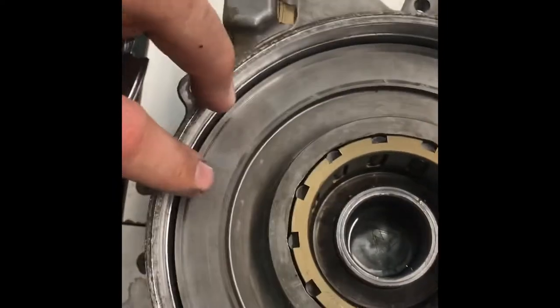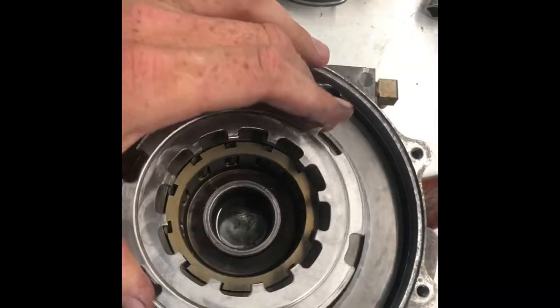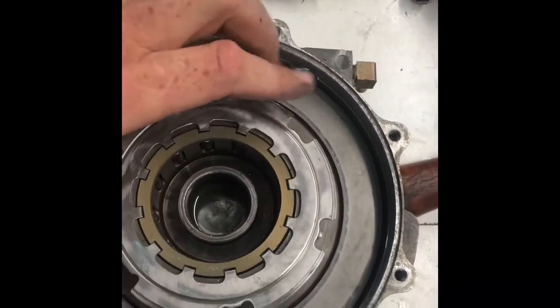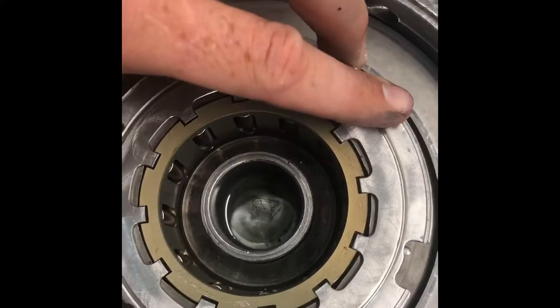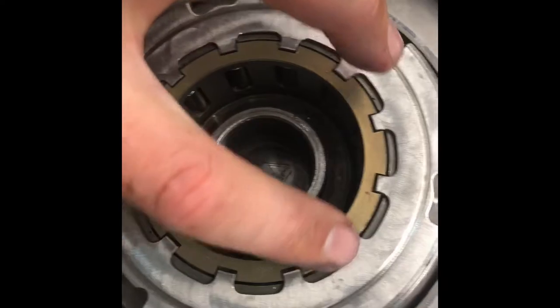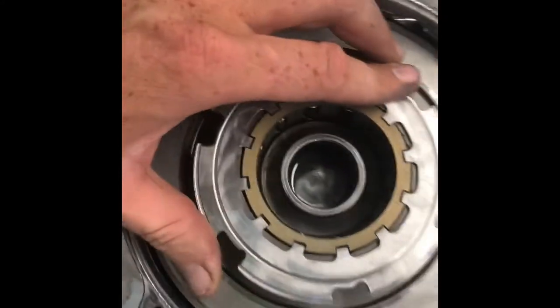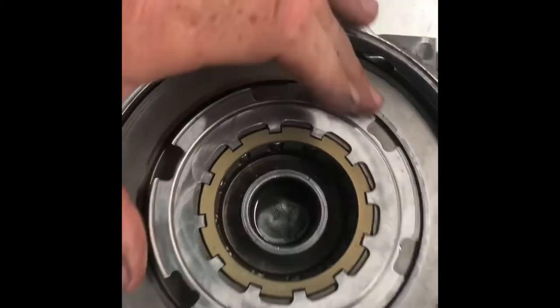Here's a quick rundown on how these diffs work. This ring gear is shaped like a socket, and every roller fits in its groove. When the magnet in the side case grabs on this plate, it creates just enough resistance to let everything twist. When it twists, it pushes the rollers out of their grooves to these little ramp areas, and the ramp areas grab the actual hubs that hold the axles. The harder it binds up, the harder it grabs — therefore you've got four-wheel drive.